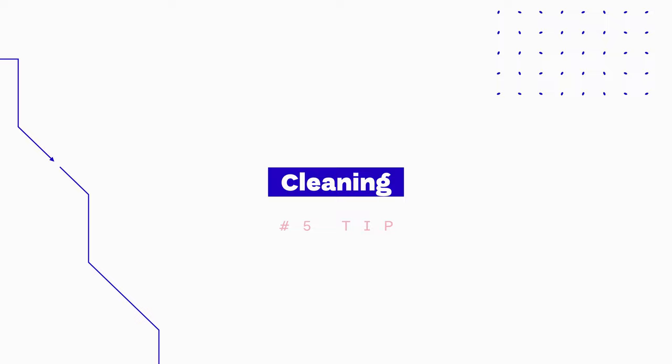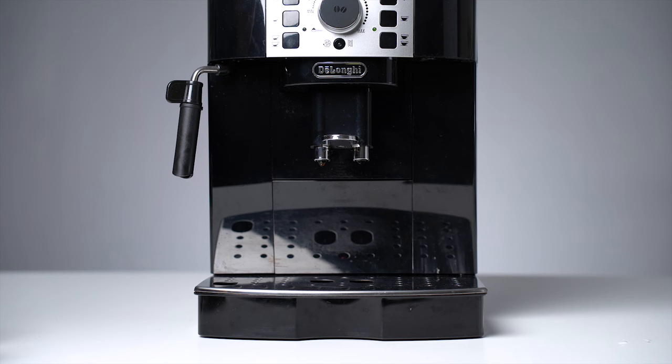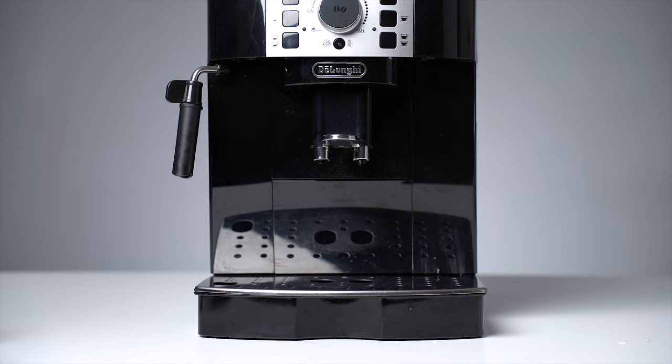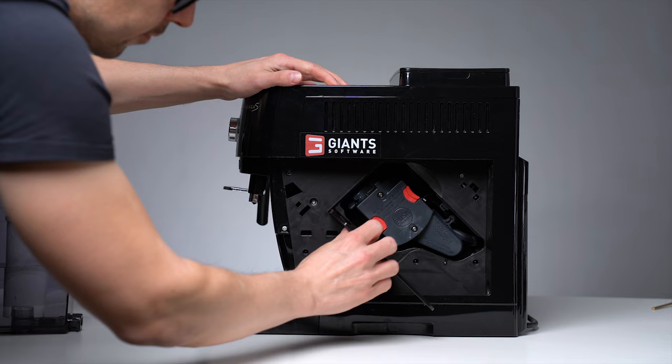Cleaning and maintenance is in my opinion the most neglected part of using an automatic espresso machine. The user manual is actually pretty good at describing cleaning routines, so go ahead and look at it if you haven't done so yet. After every brewing, I like to rinse the coffee spout with extra water to immediately remove most coffee droplets. If you use the steam wand, it should also be cleaned immediately after use. Every day, it's a good idea to clean the ground coffee container and drip tray — otherwise you might end up with dirty water flooding your kitchen counter. You should also clean the coffee spout with a wet sponge or cloth often. Every month or so, I would open the inner part of the machine to clean the coffee infuser properly and brush out all the ground coffee from the inside.